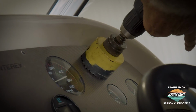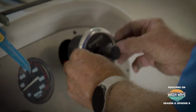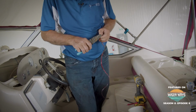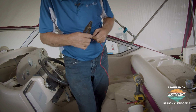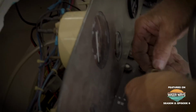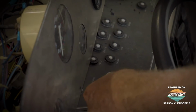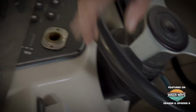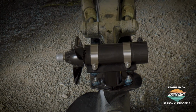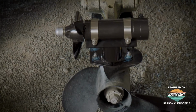And then it's down to mounting the joystick, which can be tricky based on how much real estate you have at your helm. And then we were able to connect that to the 12-volt cigarette lighter to power the joystick. And it runs on Bluetooth, so there's no wires to run directly from the engine compartment up to the joystick. Give it a couple tests, and Bob's your uncle. Let that sealant on the holes cure, and then you're ready to splash it.